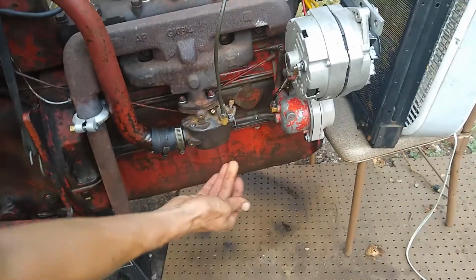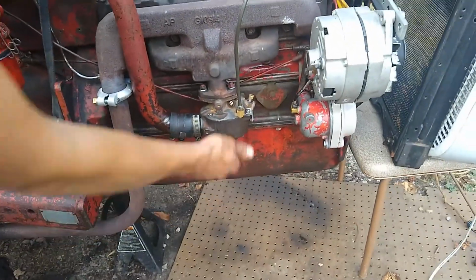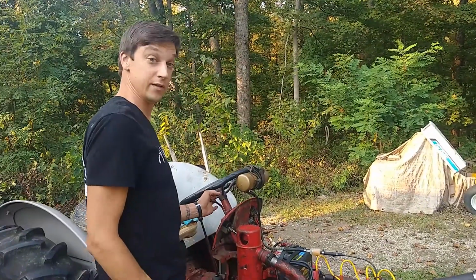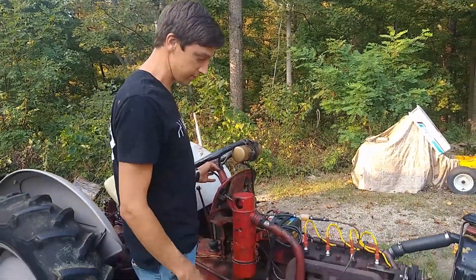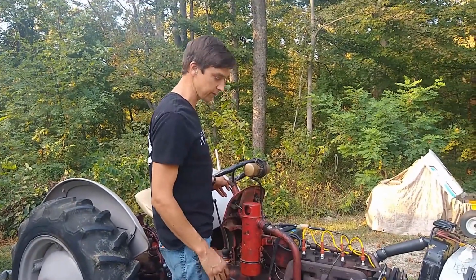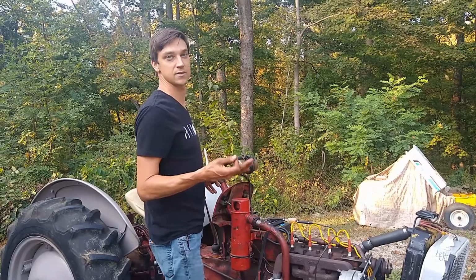The carburetor started leaking. It's not leaking right now, but just give it time, it will, I'm sure. It didn't leak for an entire week, and then I went over and I've already had the carburetor apart 3 times, so I'm just going to have to get a rebuild kit for it. The float just intermittently doesn't seat.